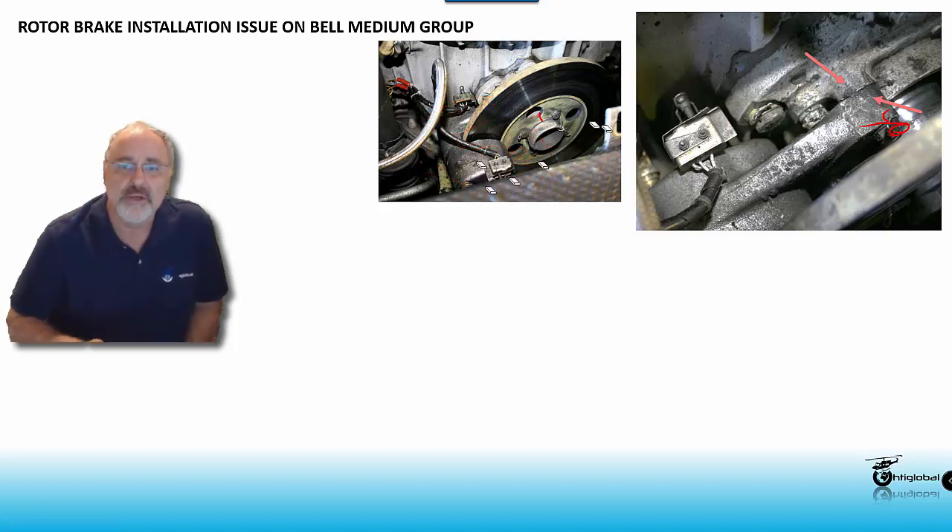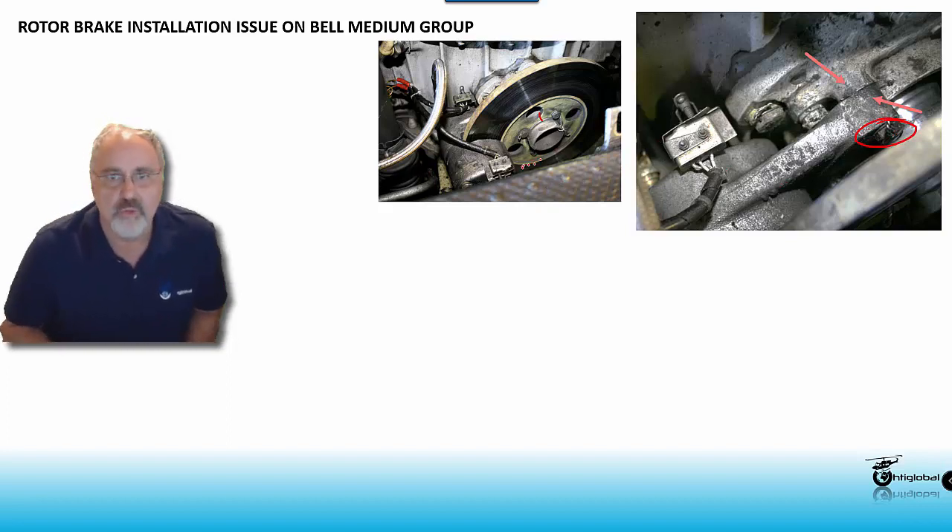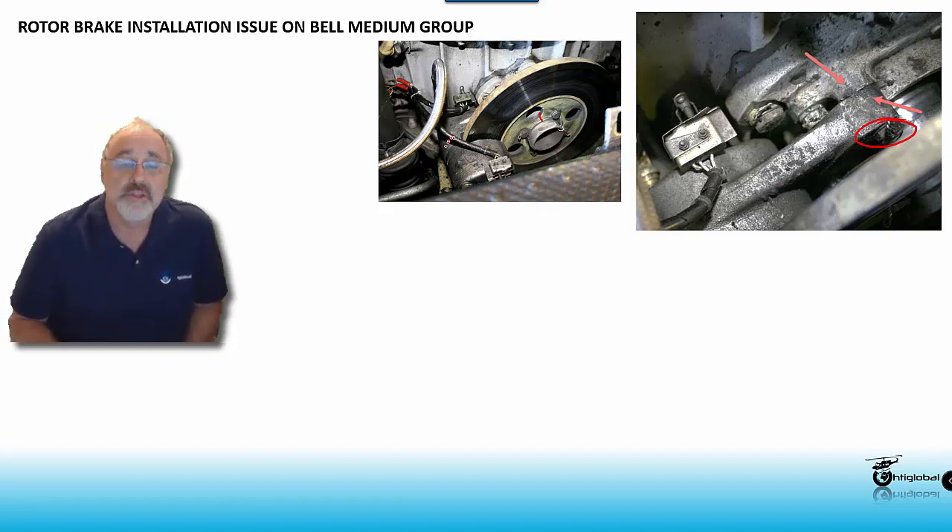Removing is one thing. When you're going to install it, you have to remember that this bolt uses a cross safety wire, not a single safety wire. The correct process is as follows: first, remove the outboard caliper, then remove the disc, and finally remove the inboard caliper. When you install it, the first part is the inboard — install the three bolts, torque it down, and safety wire. When you finish that process, then install the disc, and finally the outboard caliper.